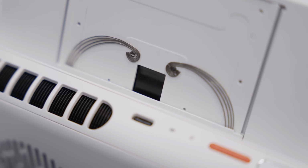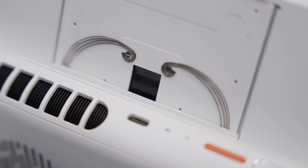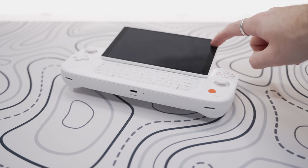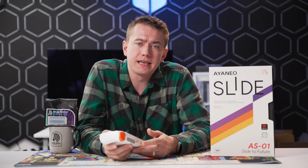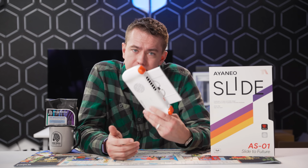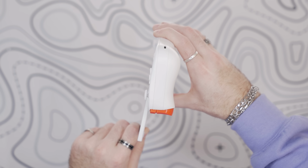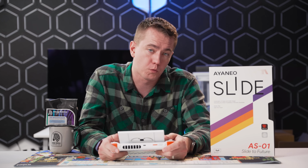They also didn't have a cutout in the back that lets you directly touch the ribbon cable and panel of the display. And the springs, if they break, aren't the problem since you can just manually slide it up and down into place. What is an issue is the exposed ribbon cable to the display. You tilt the screen too much or accidentally snag on something, and congratulations, you don't have a working screen anymore.